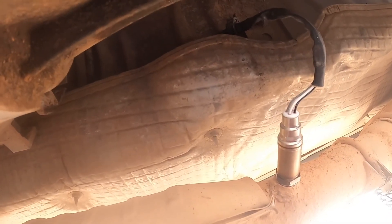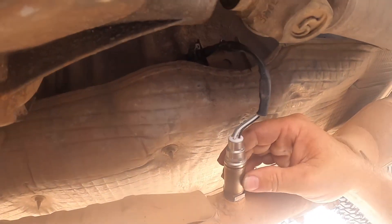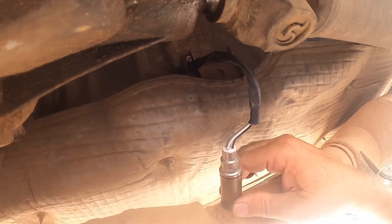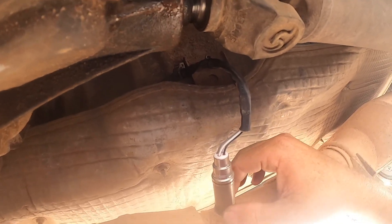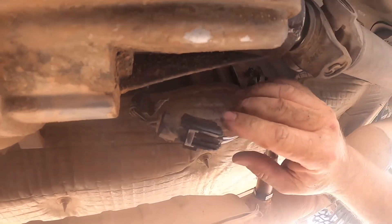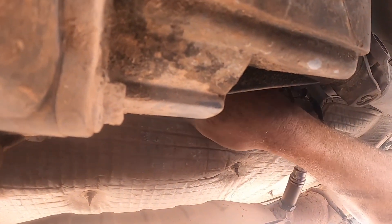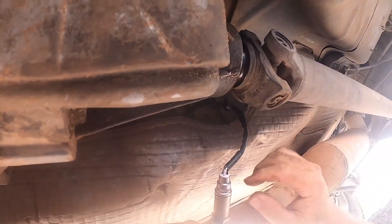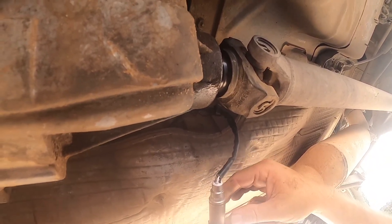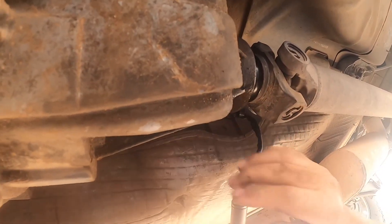My camera shut off again. Basically this is your oxygen sensor, and here's the new one - the Bosch. A little beefier than the cheap one I had in there. It's a seven-eighths or 22 millimeters, real close, kind of tight. You take the old one out, unplug it from the connector and this little keeper that keeps it from hitting the driveshaft. I like to stick the connector in the little heat shielding right there behind it. Disconnect it, loosen and take the old one out, slide the new one in, don't crank it too tight - there's only a few threads on it - then connect everything back up.